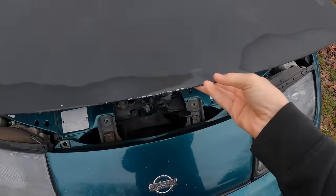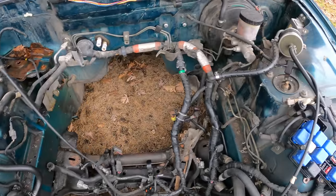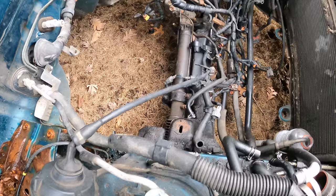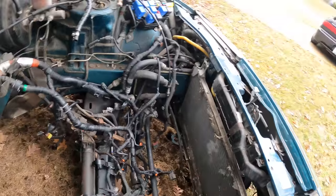It shouldn't be too hard to fit a KA24 in here considering it had the massive VG. There are some things I want to verify before dropping the motor in, because I know I'm probably going to have to make custom motor mounts. What I was thinking is to try and mount an S14 subframe in here so that the motor mount locations would be in the correct spots — which I didn't bring, so I'm going to stop at the garage and pick those up.